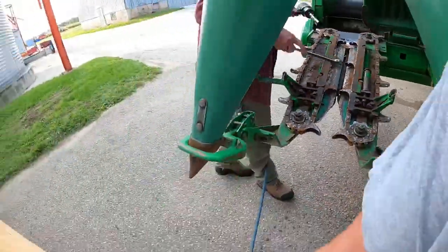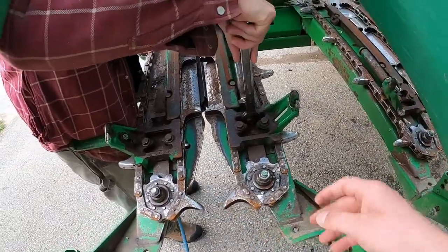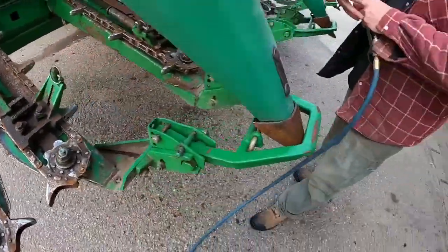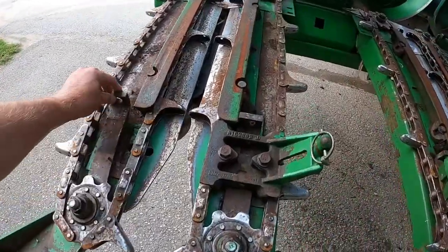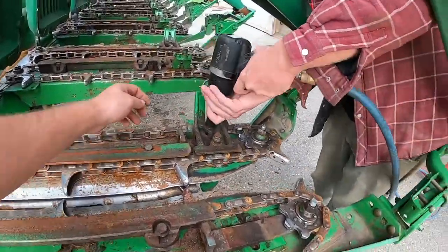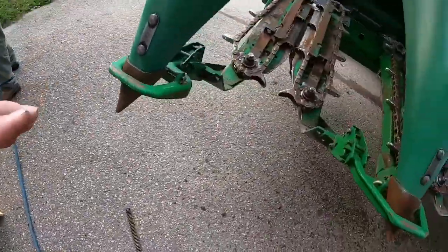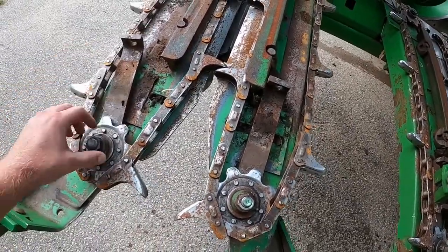Then we'll give them lube. Why are we cleaning all this up? Yeah, for sure. Okay, we're gonna take all these parts — that one's wire wheeling them — get them really super clean so everything moves freely in these chain systems, or these wear out quick. But we're gonna replace the chains and sprockets too.